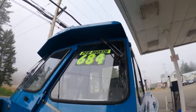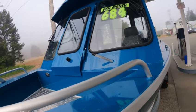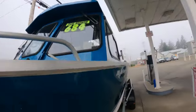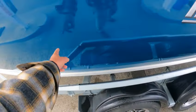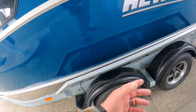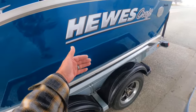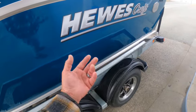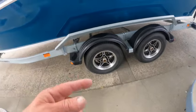Dual wipers, overhang hood to keep the glare off your electronics, two-pin half window you can remove if you like. It's got grease zerks on there as well. You've got a chine that goes out reverse-flat to keep the water down. For the chine guides there — I like to see those just a hair away from the chine, because you can still get off if you get too much of the trailer in the water, tides going out, wind blowing — you can run up on this side, but it does the job.